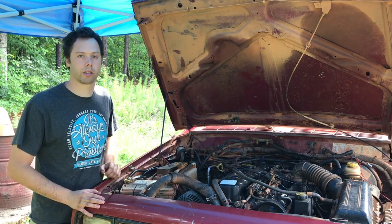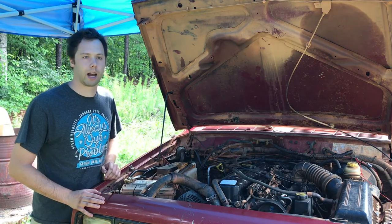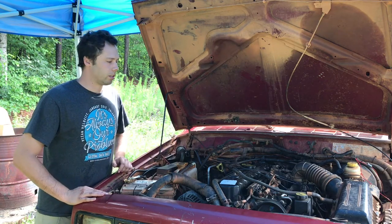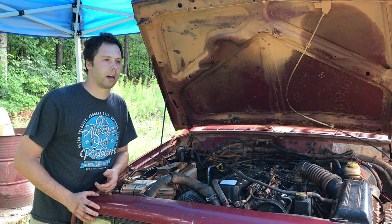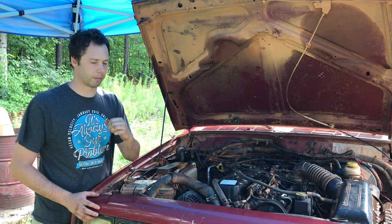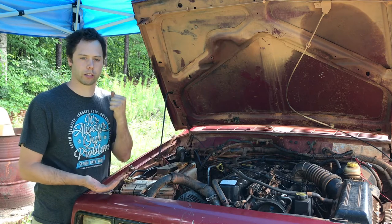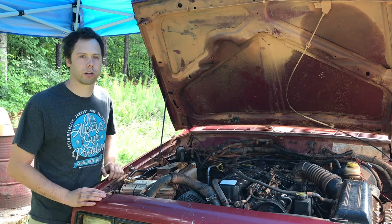I did not properly time the motor. I thought I had it timed. I was actually 180 degrees out, or a stroke out. So I remember last night, I was like, you know what, when I timed it, I didn't seat something into the spark plug hole to build pressure. On a compression stroke, you'll hear this thump. You'll hear this puff of air come out on a compression stroke.